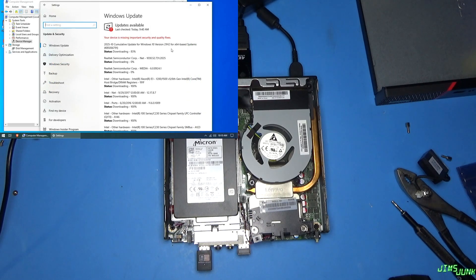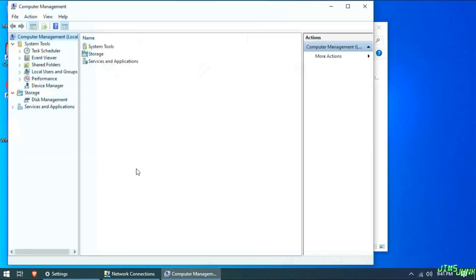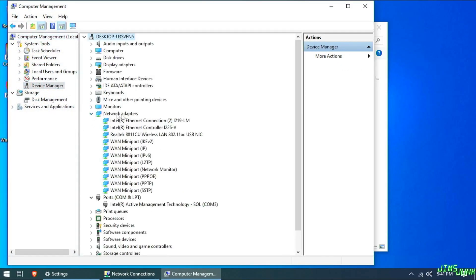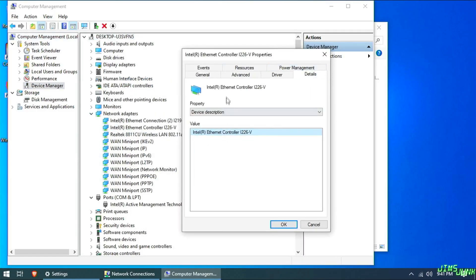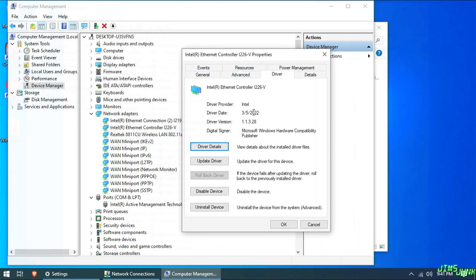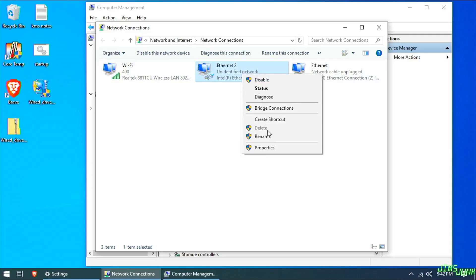I have another laptop here. We'll make sure it can actually get a link and test the speed. That was a bit more trouble than I expected for just a quick test. Since this is a cheap Chinese board, the Intel drivers only seem to work up to version 28.2. Anything above that gives a certificate error. Everyone on forums says to just install 28.2 — I installed 28.0, because that's all I could find. This again is only for a test, so I don't really care. I just want to see if the card and the board can give decent throughput.